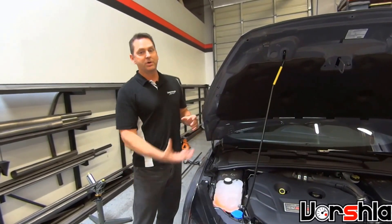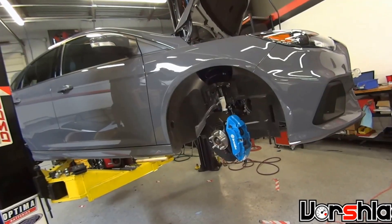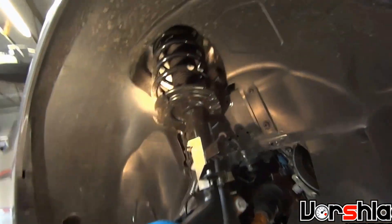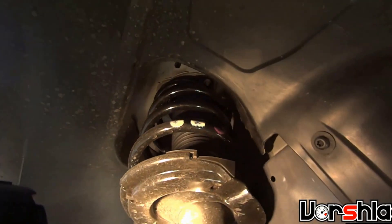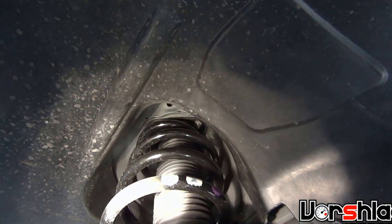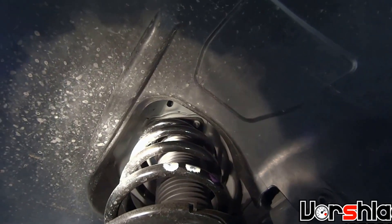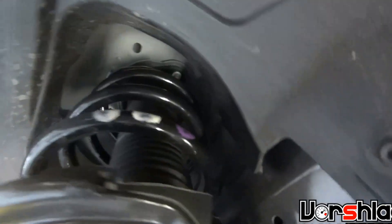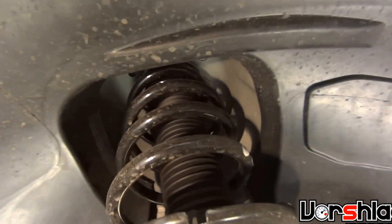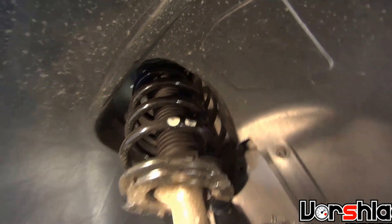Next we'll show underneath and show you the physical constraints. We got the Focus RS up in the air with the front brakes off for getting weights, and that gives us really good clearance to see what's going on in the strut tower. That giant OEM spring is not going to allow us to do any camber adjustment worthwhile — we might be able to move a quarter inch, but to do any real camber adjustment we need to move about three quarters of an inch. We've really been stuck on this one. No way are we going to make an OEM camber plate for this chassis — not for these springs. It's got to be coilovers only.